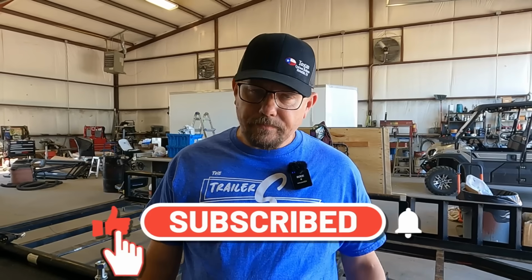They would call and say, this trailer's worked fine. We'd ask the question, and they'd say, I got a new pickup, the wiring must be different. We get that all the time. My Chevrolet's wired different than my Ford. Well, really, they're not. The colors in them may be different, but pin locations have always been the same. There's been a little difference on the trailer side depending on the 6-pin and the 7-blade RV style plug. There's been some changes on that. And even on the 6-pin, depending on whether you had an aluminum trailer or a steel trailer, there was a couple changes on that when it dealt with the brakes. But the ground was the ground. Now, white doesn't make the ground the ground. What makes the ground the ground is the pin location that it's in, in your trailer plug, in your truck plug, where you make the connection, and what you've done.